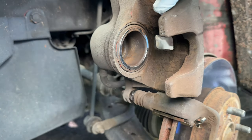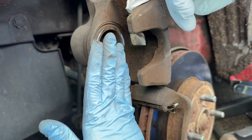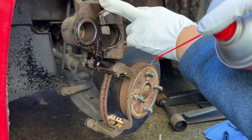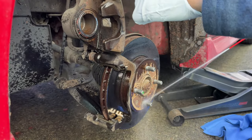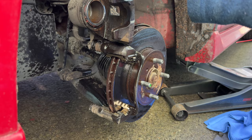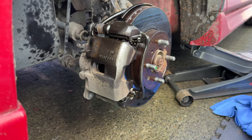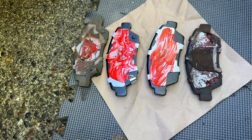You want to make sure the seal can always expand properly, so don't damage it. You should be wearing safety goggles when working on cars at all times — I own a nice pair of DeWalts. Dennis is just cleaning everything up. Let it air dry — it dries really quick — and in the meantime we're going to pick out our brake pads and match them up.